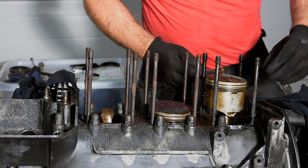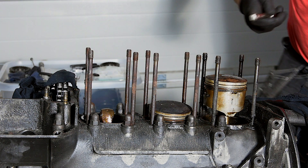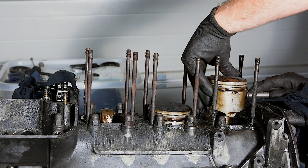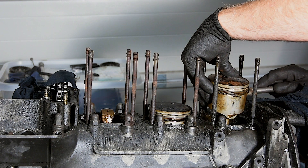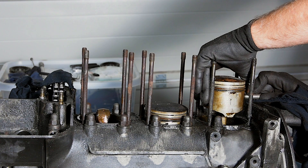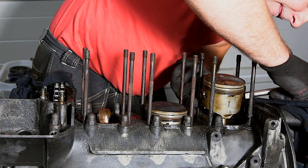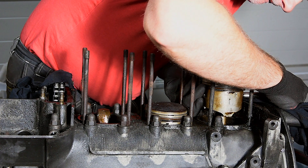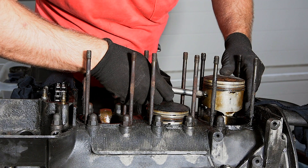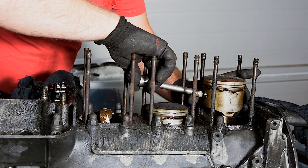You need to be cautious when you rotate the crank so neither the con-rods nor the cam chain get caught in any way. These pistons have floating pins that are kept in place with circlips. You get those circlips out with a small screwdriver or a pair of needle nose pliers. After removing the clips, you need a tool for pushing the pin out — it needs to fit inside the bore for the pin in a way that doesn't cause damage to the bore inside the piston and the small end bearing in the rod.